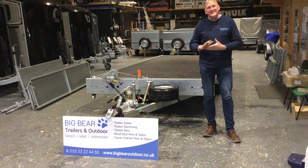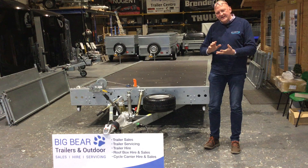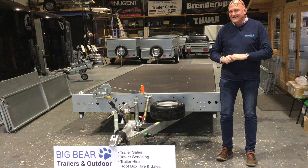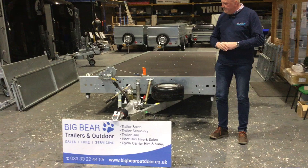We've got a review for you on the Woodford FBT231. This is one of the Woodford flatbed range — there's a myriad of options in this range. This is the FBT231, which is the 18-foot by 7-foot 3-wide trailer, three and a half tonne gross, and it comes out with a payload of 2,560 kg. We're going to use this review for both the 16 and the 20 foot because broadly speaking they look very much the same — it's just the dimensions in terms of length that alters.